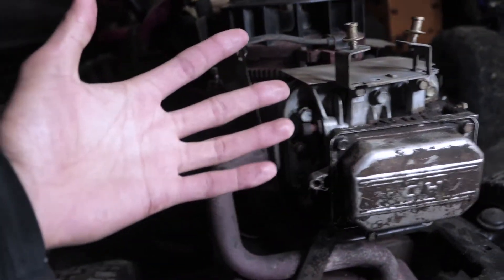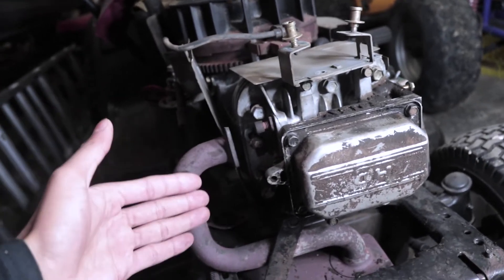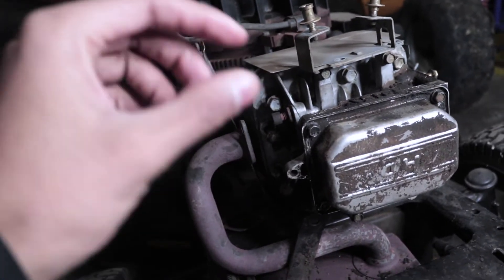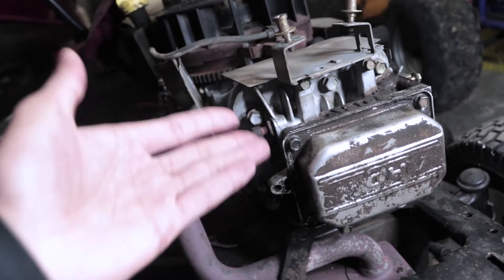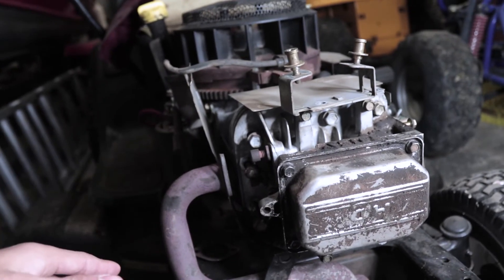Number five, which is the case on my motor here — an 18 horsepower Briggs — it has a bad head gasket. That was caused, I'm pretty sure, when I did not change the oil and it got to a level that was way too low. The motor got way too hot and then I lost compression. When I opened it up I was able to notice that the head gasket is bad, so that's going to get replaced soon.